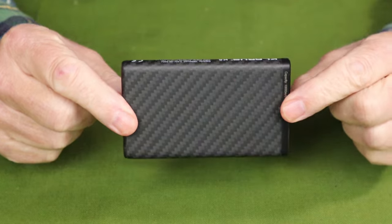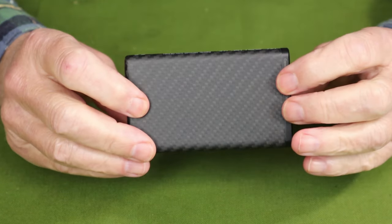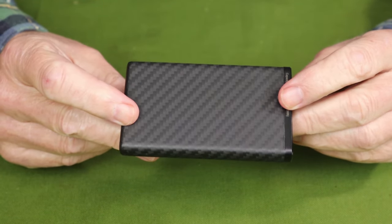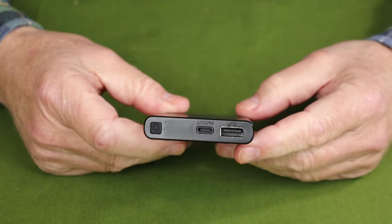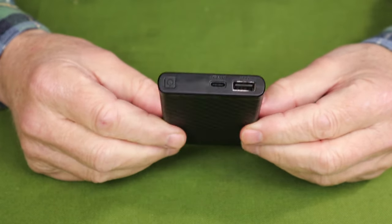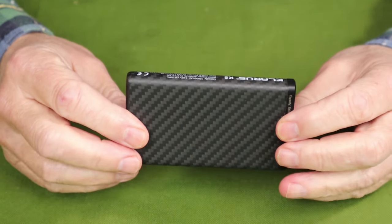I'll be taking this with me when I go out for things like cell phones, headlamps, and flashlights that have to be recharged. It is a 10,000 milliamp hour battery, and that's also impressive given the size of this thing. One of the other features I really like is that it is USB Type-C PD fast charge capable. This will charge with 22.5 watts through my wattmeter, making it a very quick-to-recharge battery. It also has trickle charge capability output, which I'll talk about in a minute.